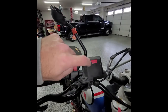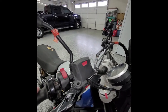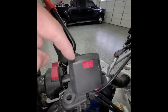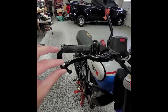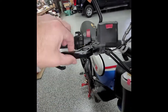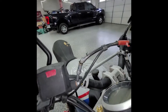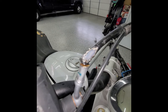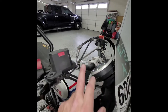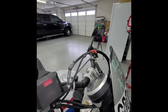Once we replace the master cylinder — so see the line? The master cylinder itself is fine. I'll probably just clean up the tip, grind it down nice, get this powder coated because this is actually good. I'll try and get a new cover for this. I have to get a new brake line — look at that damage right there. The throttle works fine, although the line is kind of chewed up right here, so I'm probably going to have to get a new throttle line.